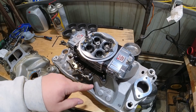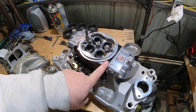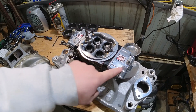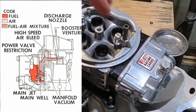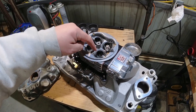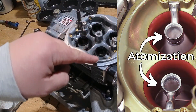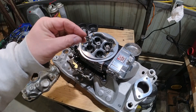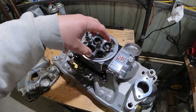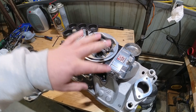To understand the ins and outs of each intake manifold, everything actually starts at the carburetor. Fuel comes into the fuel bowl, flows through the metering block, and out the booster. The air bleeds emulsify the fuel — emulsification is basically mixing the fuel with some air to make it easier to atomize. As fuel flows out the booster, it gets atomized as it enters the airstream and ultimately vaporized as it goes through the intake tract. That means it's actually a heavier-than-air mixture of air and fuel flowing through, not just dry air like a fuel-injected setup.